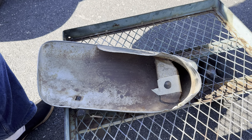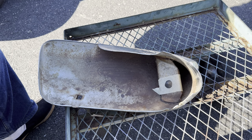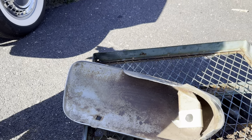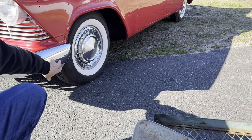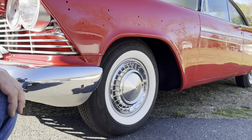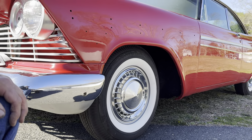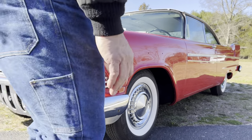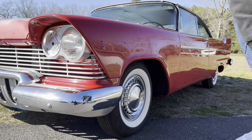That height takes up the space because there are sometimes gaps between that inner bracket and the bumper that the factory would have shimmed using washers or body shims. So the putty basically compensates for any variations you might encounter when setting the wing on the car. Also, remove the outer carriage bolt from your bumper that connects it to the valance bracket — you want that open to help sit the wing on as accurately as possible.